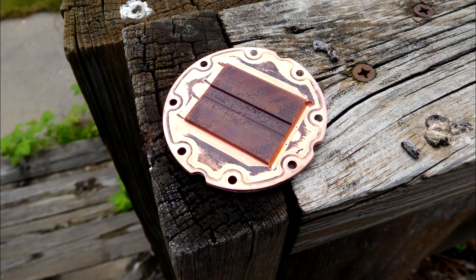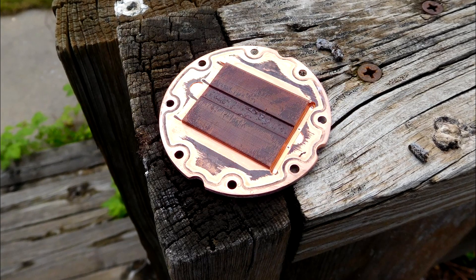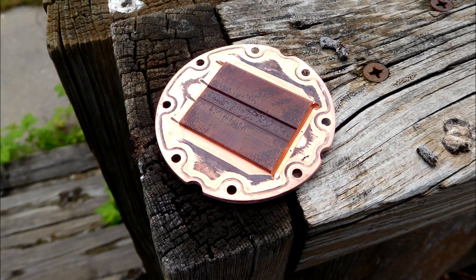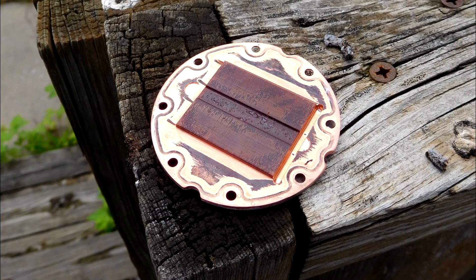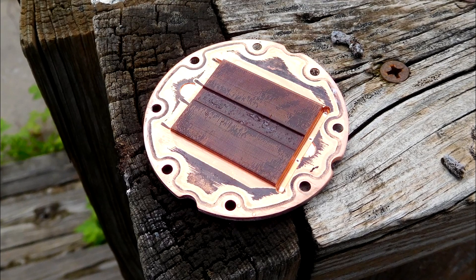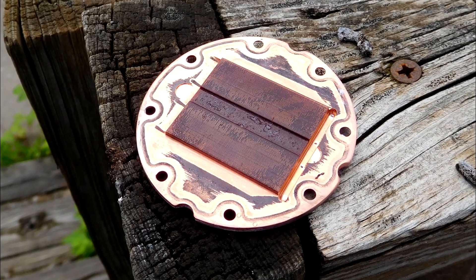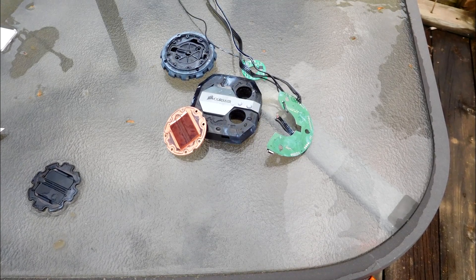So I have absolutely no idea what was wrong with this cooler. I kind of have to speculate that the pump actually did die, or more likely that it was on its last leg. Normally if a pump dies, your CPU overheats within minutes of having your PC on. I was able to use my PC, I just couldn't game or edit, so perhaps the motor was only spinning at around 300 RPM or some crazy low number. Just keep in mind the normal operating frequency was 2000 RPM, with a setting to go up to 3000 - and it did say it was running at 3000, but it just was not cooling my CPU.